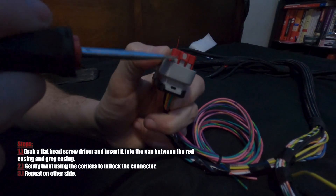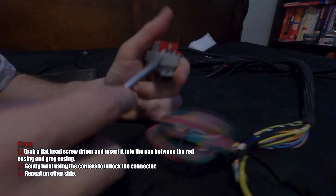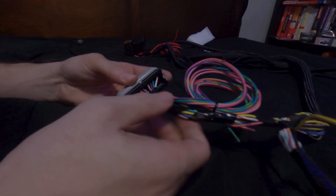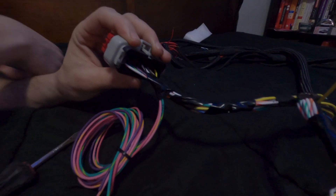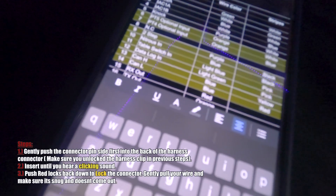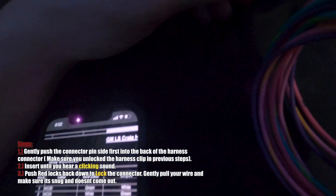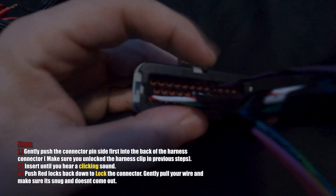Now I'm going to show you how to take these extra wires and put them into the ECU. To open the connectors, get a flat head screwdriver and place it between the gray and red part, then give it a little twist — you'll see it raises right up. Do it on the other side gently so you don't break anything. That allows you to put new pins in. This connector is also numbered. I have the install guide pulled up on my phone. For this demonstration I'm installing the two-step line, which is pin number nine. Go ahead and put it into slot nine and you'll hear it click.